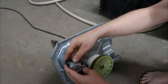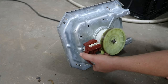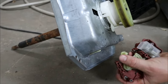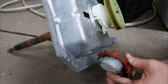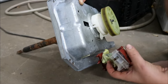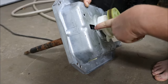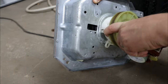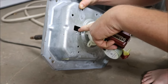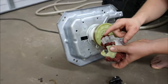Here's the actuator. They're either going to sit here — it's going to be either this black one or this red one — sitting just like that. There is a little lever right here, and this on the actuator is a handle that goes back and forth — that's all it does. It runs on this motor. All this actuator does is mainly shift this back and forth. On this other side, it's pretty much to know when the machine should unlock — it's counting this little guy right here. It can sense, I'm guessing light or maybe a laser or something going through it, maybe magnetic, but it's counting and it knows when the machine comes to a stop. When it comes to a full stop, it unlocks so you don't stick your arm in it while it's spinning. That's pretty much what this side of the actuator does.